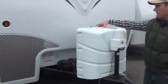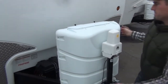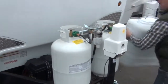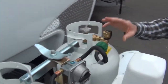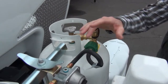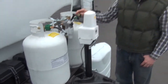On the propane tanks you have a quick open flip top so you can access the valves. On this particular unit it comes with a barbecue tee to where you can hook up a 12-foot hose out to your barbecue. The nice thing about this is it's before the propane regulator so you're running high pressure, so you can run your Webers and your typical high pressure barbecues.